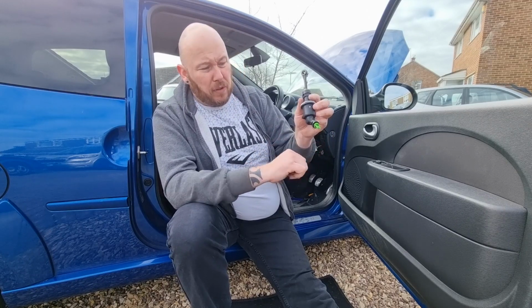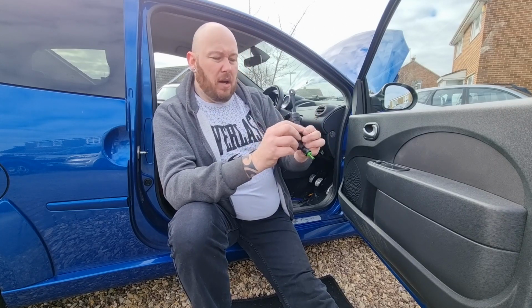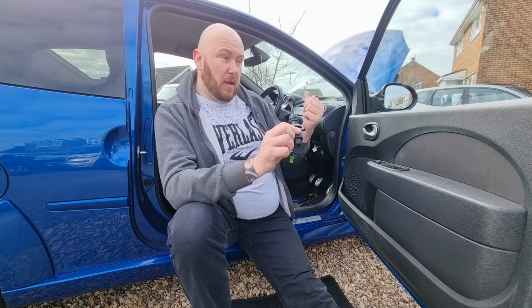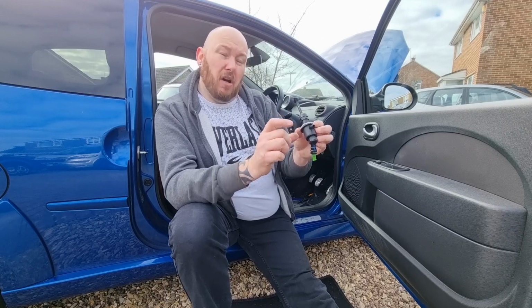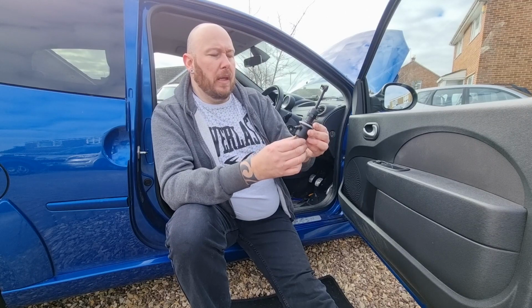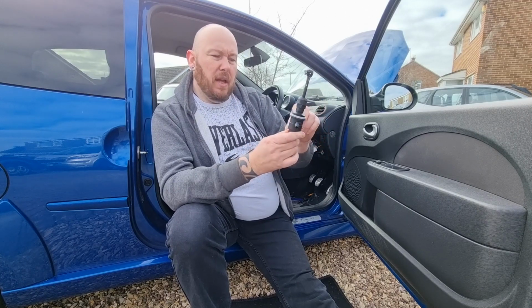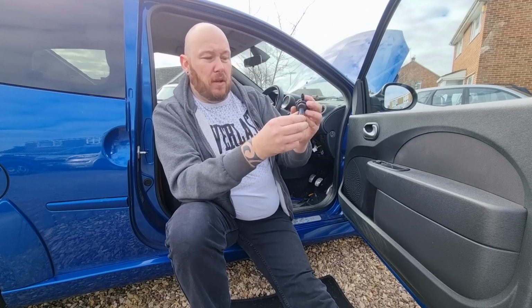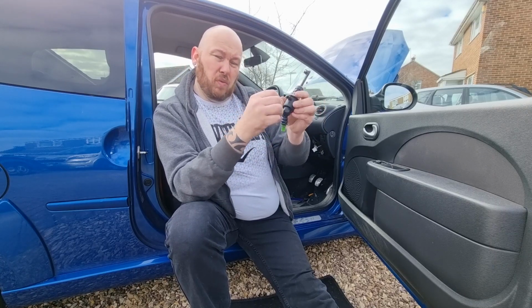Essentially what I've got to do is, this is the high pressure line going out to the clutch. This is the inlet from the actual brake fluid reservoir, because the brake fluid and the clutch are fed by the same bowl. It's relatively straightforward. It's got a system where you can unscrew it without any tools. The only thing I've got to do is take the clip off and put the existing hose onto that.